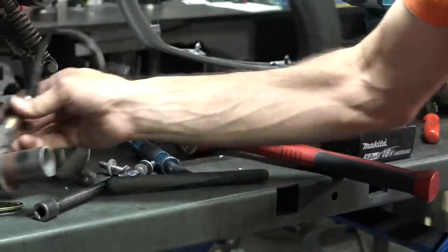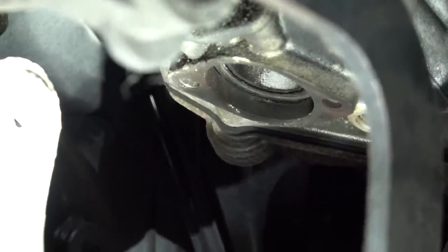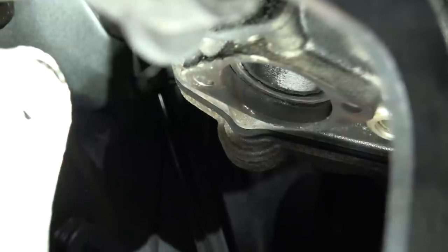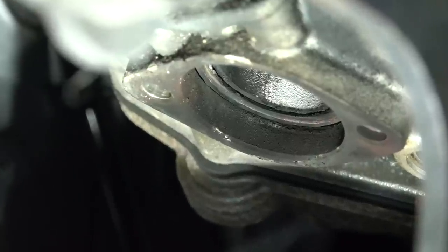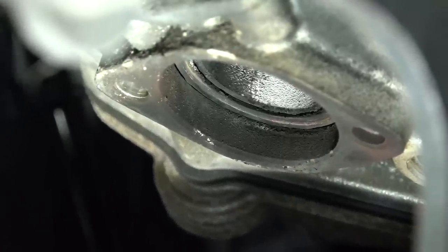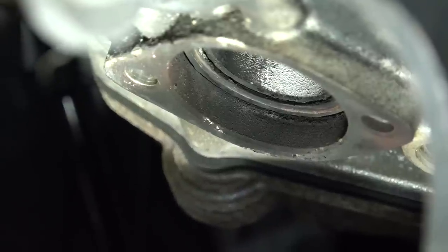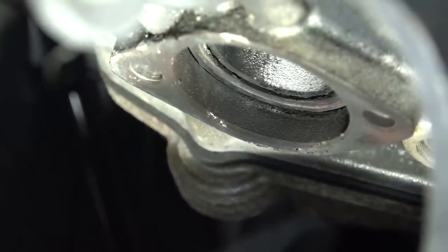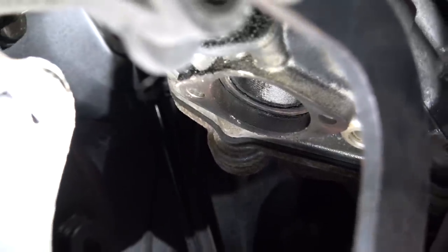I suspect it's broken. One stud that I pulled out is gone; the other one is straight broken in there with the nut seized to the stud, so you want to replace both the stud and the nut. The manifold's hanging. The actual manifold looks fine — no cracks around the O2 sensor boss. You've got to either partly drop the motor or pull the whole entire motor out to repair that stud and drill it out. I've covered that in a video in the past. Get that fixed, put a new exhaust gasket, and I bet this thing's going to idle like a kitten.